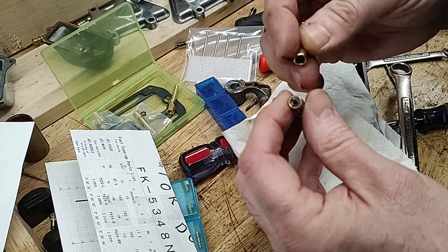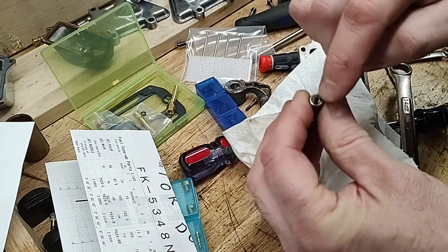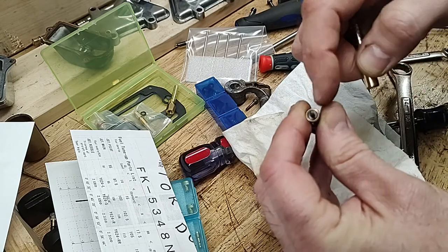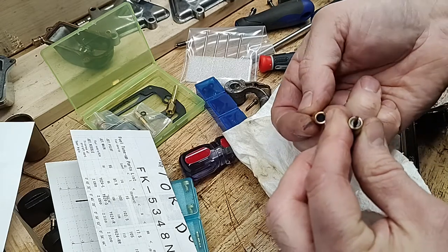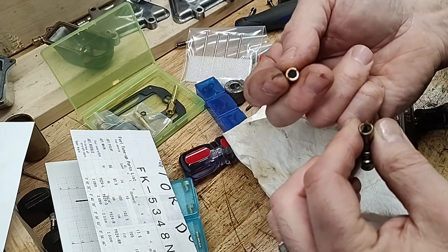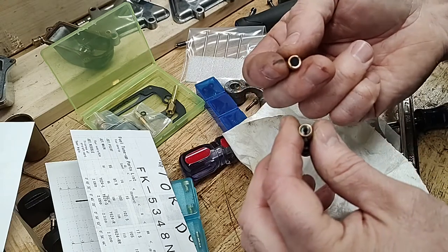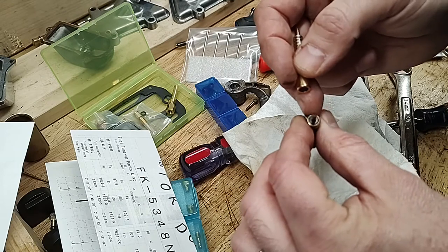However, the rubber seal at the base of the plunger should be changed. This is fossilized. The kit does not include a separate seal with an opening for a pointy end. I'm left to remove this seal in this plunger that I'm not going to use and pray to God that I drill a hole in the center of it to accommodate that pin and fit snugly there.